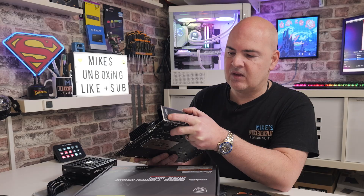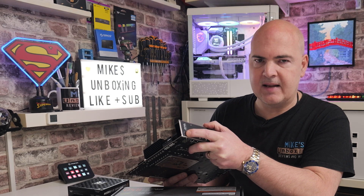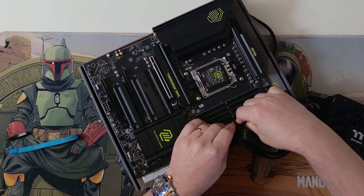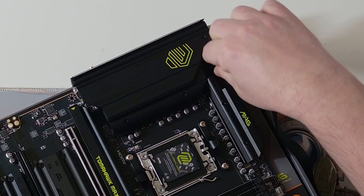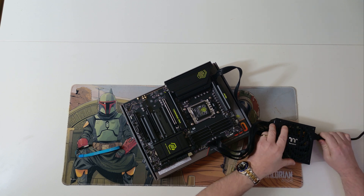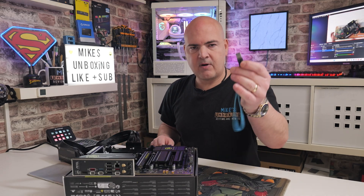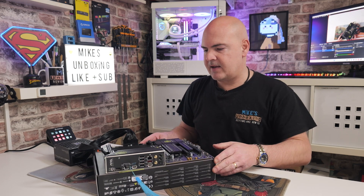You'll notice the Clear CMOS button is slightly raised, while the BIOS update button is a little bit sunken in so you don't accidentally press it. Let's get this set up. Start with the main 24-pin connection to the motherboard — plug that in firmly. Then connect the CPU power cable to the top of the board — either port is fine. Next, plug the power supply into mains and make sure the power supply switch is in the off position. Once ready, turn on the power supply, grab your USB drive, and plug it into the appropriate port — the one with the rectangle around the outside edge.